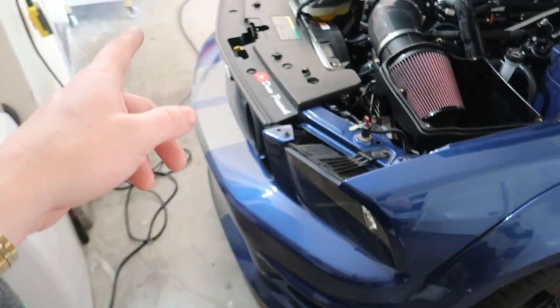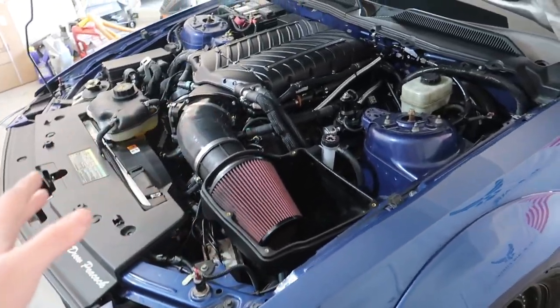The oil cooler is right there — hopefully you guys can see it. It seems like it's actually doing too good of a job. My oil temps are pretty cold when I'm cruising on the highway. When I get on it or do street driving it flattens out around 180–190°F which is perfect, but on the highway at 60 MPH at night it's reading around 150°F, which is pretty cold.